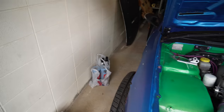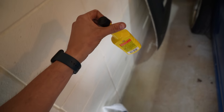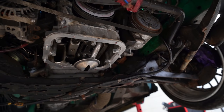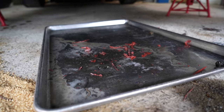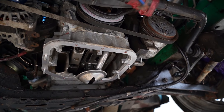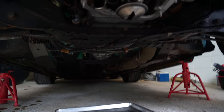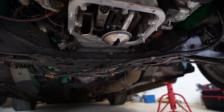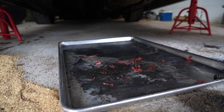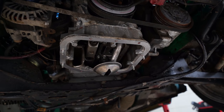I've got the oil pan cleaned up - I've already inspected inside the engine. I'm going to RTV seal it all up, put it back together, put fresh oil in, and mess around with the Apexi to get a leaner tune so it's not dumping so much fuel. We also grabbed some fuel stabilizer to put in the tank to get rid of moisture and water in there. Before I get the oil pan back on, I just wanted to show you that a lot of that RTV and junk came out of the pickup - really glad we pulled this and cleaned it out.